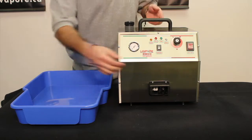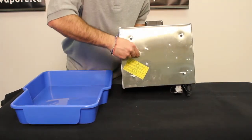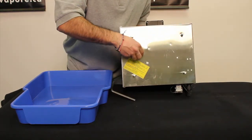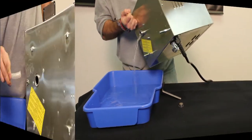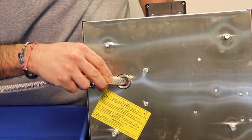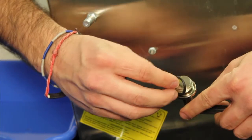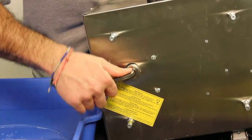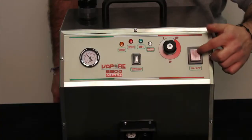Maintenance — rinsing procedure, at least once a month or when the red light turns on. Allow the machine to cool for at least five hours. Unscrew the drain plug under the machine and allow all water to drain out of the boiler. Insert a water hose into the boiler to properly flush out all calcium and minerals. Verify the o-ring on the drain plug and replace if necessary. Screw the drain plug back on and fill the water reservoir, then start the machine.